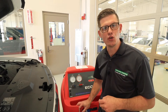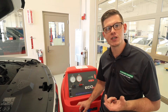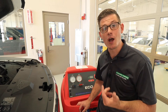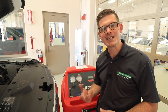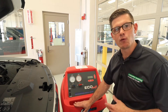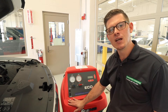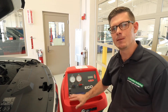After looking at vent outlet temperature and doing general inspections under the hood, the next thing I'd want to look at for AC performance are the pressures of the system. Sometimes I need to come here right away — maybe I don't get any cooling output or the compressor clutch is not engaging. This is really the ultimate way to get a good sense of what's going on. There are two ways to do this: I could use a recovery machine like this one, or a set of gauges. Gauges are much cheaper and more accessible, but having a machine like this opens me up and readies me for the next steps, so it's a time saver to start here.